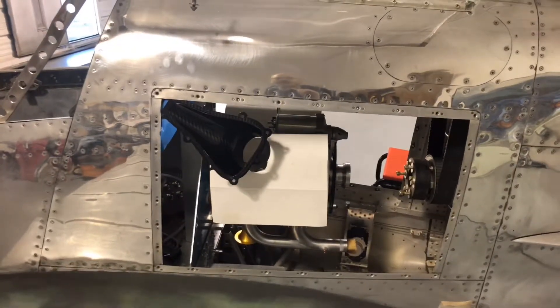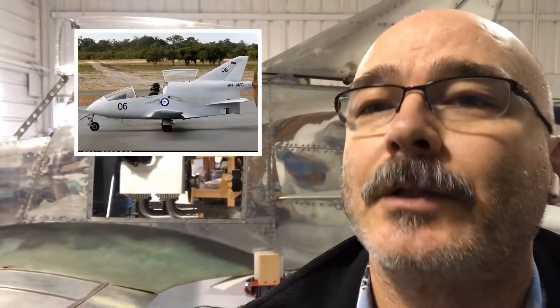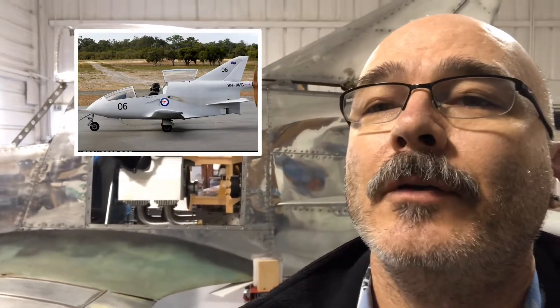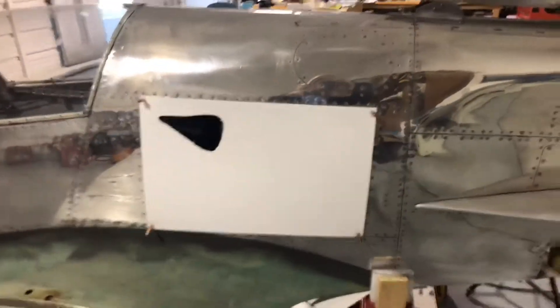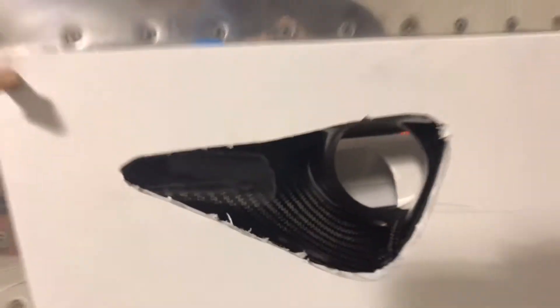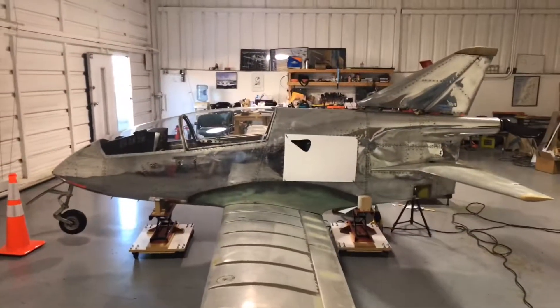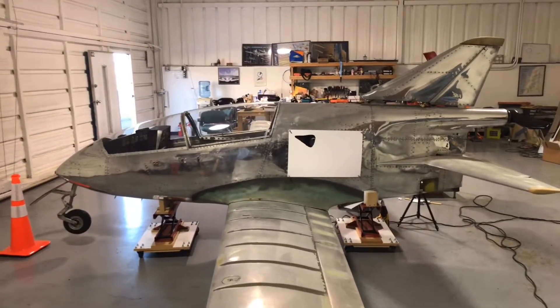You're asking yourself why I have it at such an angle. The reason deals with a picture I have of Gordon Johansson's BD-5 that shows the exhaust stain going down the engine cover from where his exhaust exits right close to this area. I can see the wind angle created by the aerodynamics of the aircraft, so it's not a straight-on shot — I have to angle that NACA duct downward to correctly get at the airflow. There's a styrofoam cover made to look like the engine cover with the NACA duct trimmed out so it fits into the cooling chamber.